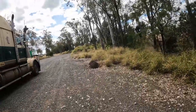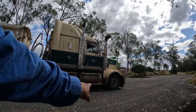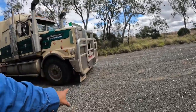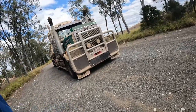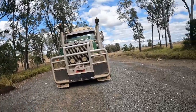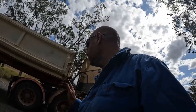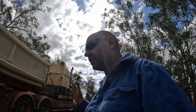I also know she's not going to lose coolant or anything else unexpectedly. When I'm walking around the truck I tend to look under the truck — under the wheels, under the motor, on the ground. When you pull up onto nice clean concrete or bitumen it stands out. Dirt hides it a little bit, but if I can see a drip I know I've got a problem.